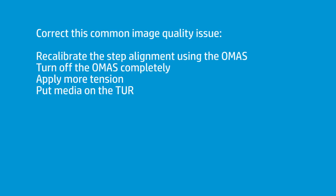It kind of flops down, or drops into the ink collectors. Once you put it on a take-up roll, if you do not say 'enable take-up roll,' it's got a wrong answer — a really wrong answer — because it needs to be recalibrated. So if you're running fabric or anything at all and you're seeing this elongated text, one of the first things I do is go to the front panel on the printer, go to calibration, and recalibrate the step alignment.